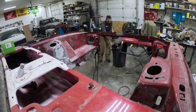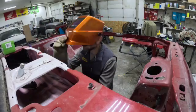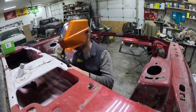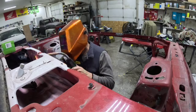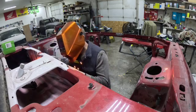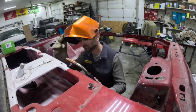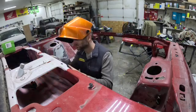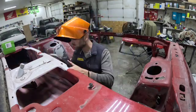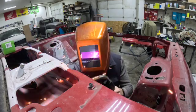I'm not a welder — I love to weld, however I really suck at it tremendously — and plug welding is the bane of my existence. Plug welding is basically taking a hole that's in a chassis and or firewall, as you'll see here, and plugging it up with welds to make it a flat even surface to get ready for prep for painting. For some reason the previous owners of this Fox Body decided they were going to put about 19 gazillion holes all over the body interior and underneath the fender wells. For what reason I have no idea, however I've had a lot of experience with plug welding and I still suck at it.